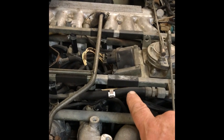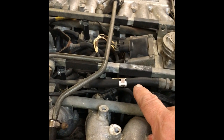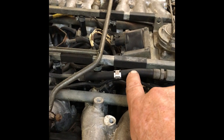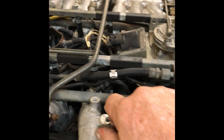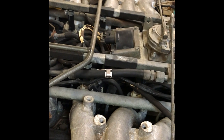That's February 15th, 1990. In other words, this power steering return line — and that fuel line more importantly — has been on this car since it came on the boat. And that's really important, because that's a fuel line right there that takes about 35 PSI. And that's almost 30 years old. That needs to be replaced, and it will be. So if you see a tag, you need to look at it and see what it is, because the probability is it's as old as the car. And it's a ticking time bomb in the case of a fuel line.